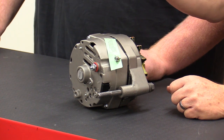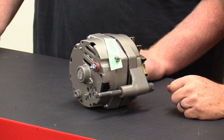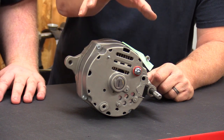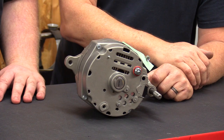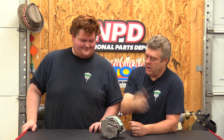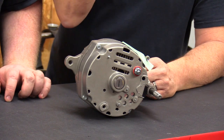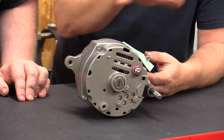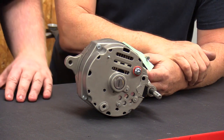One of the things I will say is — like we're doing an American Auto Wire harness in the '72 truck — it uses and is built for a one-wire alternator. There are a ton of folks out there building harnesses that are one-wire specific because it makes the harnesses cheaper with less circuits and less copper, and it's just clean. So it's twofold: beauty, and if you've got a car using one of the aftermarket harnesses, it's a good way to get into that. Otherwise, it does the same thing.